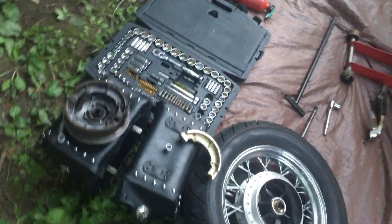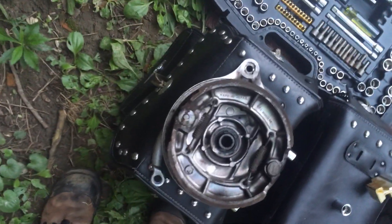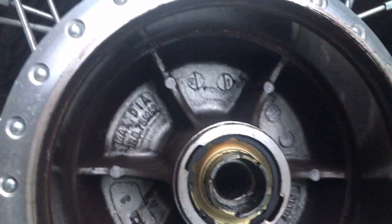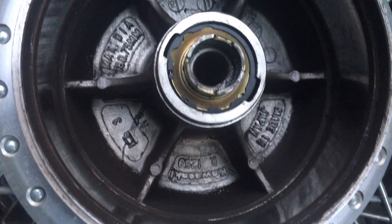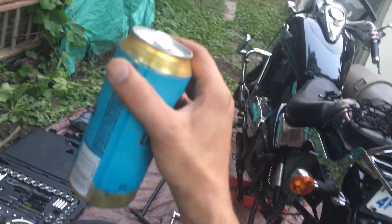Time to put it all back together. I'm going to maybe spritz some brake cleaner in there, especially in here. All that black is just brake dust, so I'm thinking the squeaking I was hearing might just be because it's really dirty. I'm going to try and clean that up. But holy crap, did I earn that. Cheers.